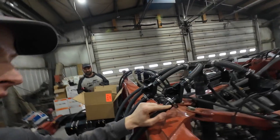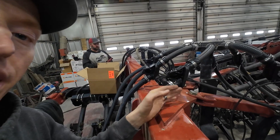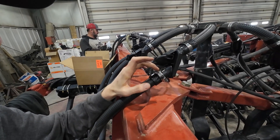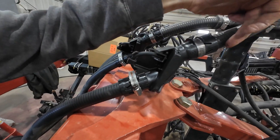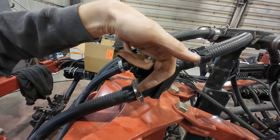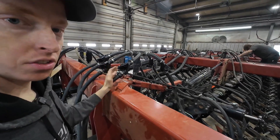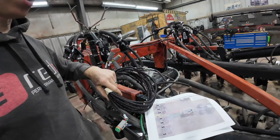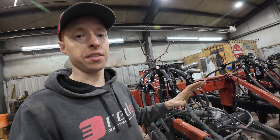Something to keep in mind: you're going to want this worm gear clamp on the side of the sensor. You don't want it where the protrusions are in the plastic. You're going to want the "in" to be on the top side — it's going to match the flow in the sensor and out the sensor. Make sure that is followed and you won't have any issues there. I like to grab all the harnesses, look at the instructions, see where they go, and then stage them on the frame before I start to unroll them and hook anything up.